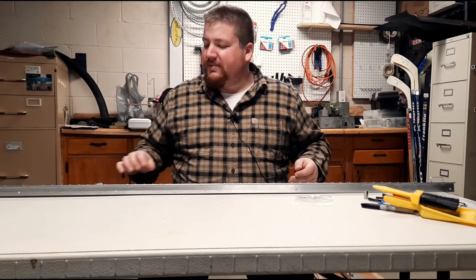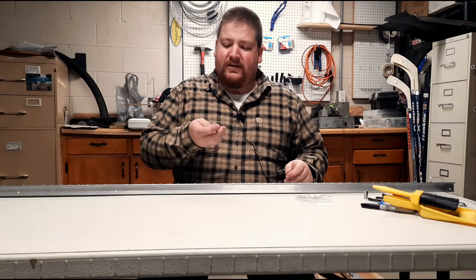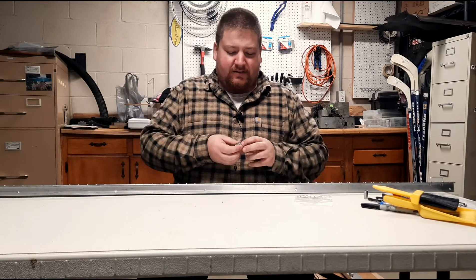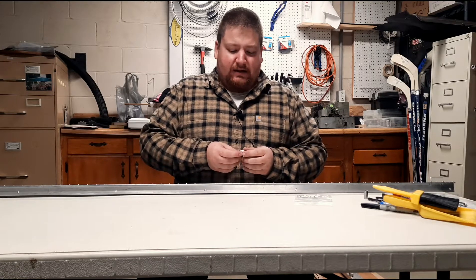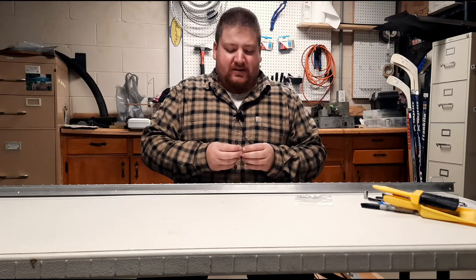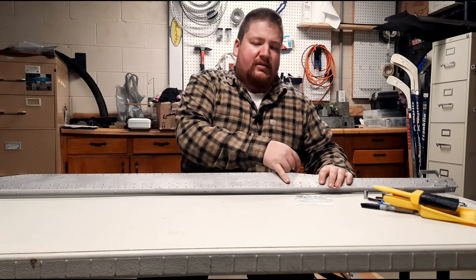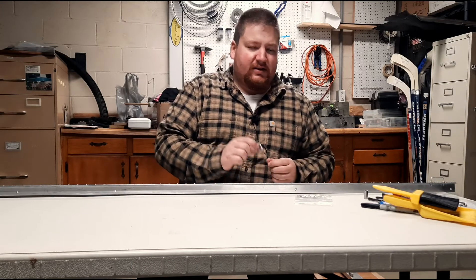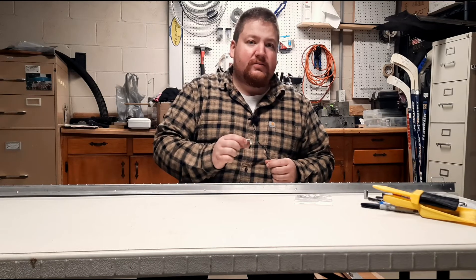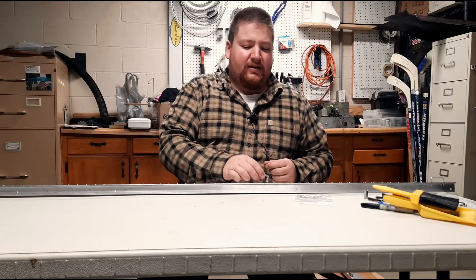Moving forward to the stake pockets, there are a couple of things here. I notice these have a bit of a smell to them. I don't think they're lead — I believe they're probably a white metal or pot metal. They're definitely not cast aluminum because they are flexible. You do need to bend these a little bit for alignment with the holes on the car. These are a touch narrow as they come out of the bag. I'm assuming that after they're cast and cool down, they shrink and get a little bit narrower.